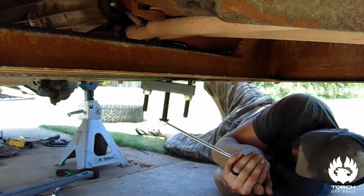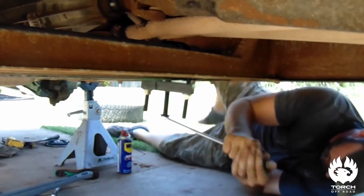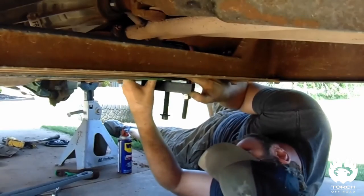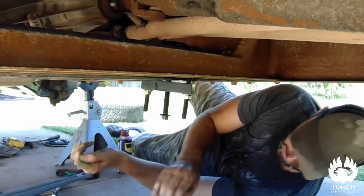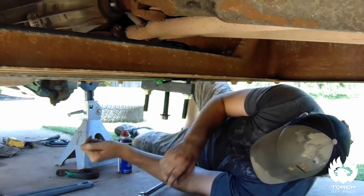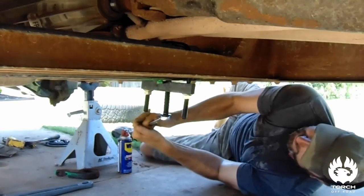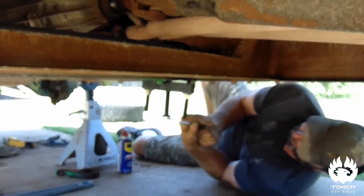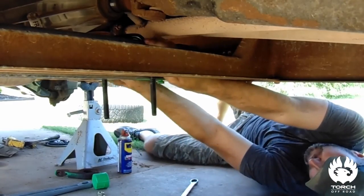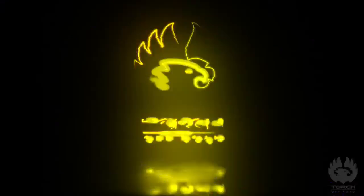I hope you're stouter than I am when you do this — this is rough. Come on, go to your home. And it's in there. Now you gotta run your adjustment bolt, then ease off your tool and let the torsion bar retainer take over. Okay, and we're done. Time to put the wheels on and clean up.